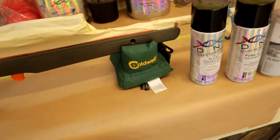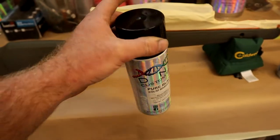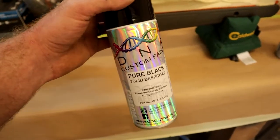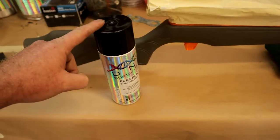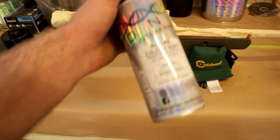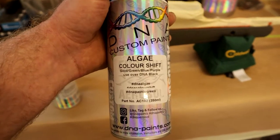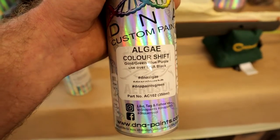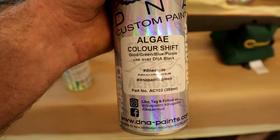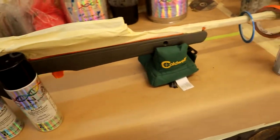Now in regards to colours — we're going to start with the DNA Custom Paints Pure Black Solid Base Coat. Solid meaning it has no pearls, no metallics, nothing like that. It's just black base coat. Once that dries, we'll probably put maybe two or three coats down, giving it probably 10 to 15 minutes between coats. Once that's dry and we've got full coverage, we're going to be swapping over to the Algae Colour Shift Pearl. Colour shift basically changes between colours at every angle you look at it — it changes between gold, green, blue and purple. It's going to look pretty cool.